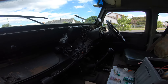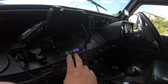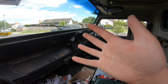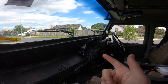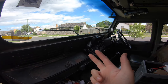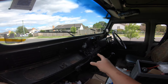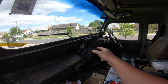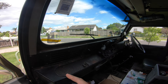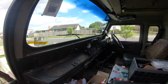I ripped the ashtray out and put in a dual voltage meter, which lets me keep track of the 24-volt system and the 12-volt system. What that instantly illustrated was that the belt squeak I'd associated with the fan belt was actually the secondary belts running the 24-volt alternator — because when I heard the belt squeaking, the 24-volt system fluctuated and not the 12-volt. I have since tightened the fan belt, and I'm also getting the mechanics to do a radiator flush.